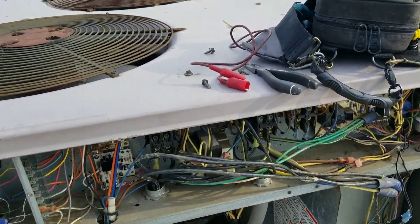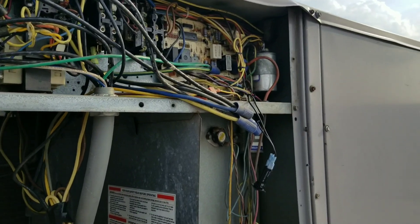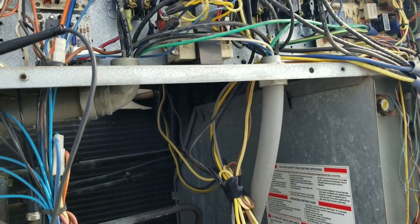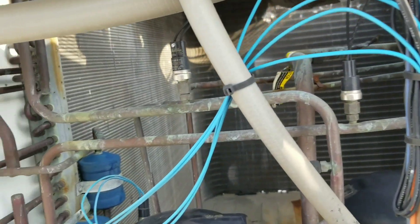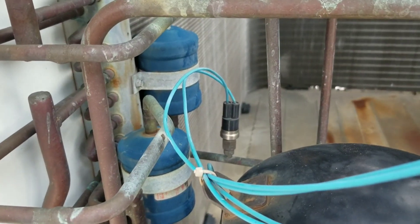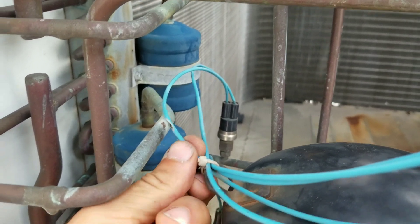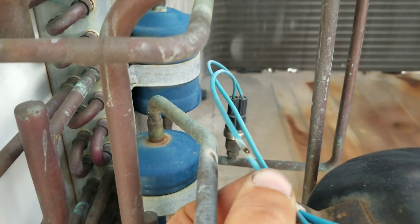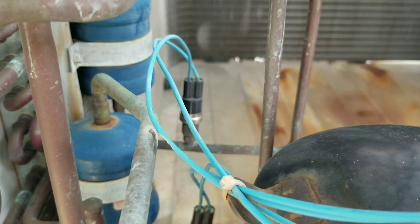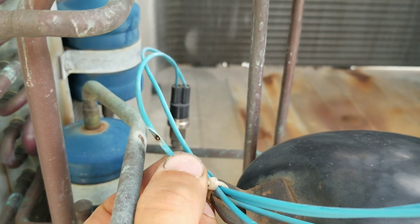Well, it took a little bit of digging, but after that last failed attempt at getting my little popper to pop, I got to looking around and just right over here I happened to notice a little burn spot. I flipped this wire around and right there you can see where it has basically rubbed through — and that's where it was shorting out.